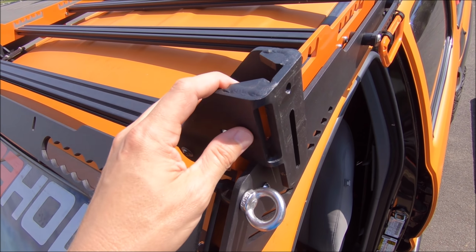And whenever you get the awning bracket in place and you have those doohickey pieces, I don't know what they're called, lined up with the holes, all you do, you take the bolt and the washer, an H4 hex bolt bit or Allen key with a small ratchet. You can't get this started by hand. You just screw it in there and tighten it down.